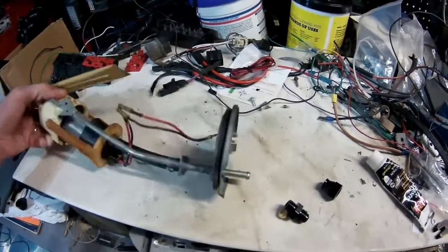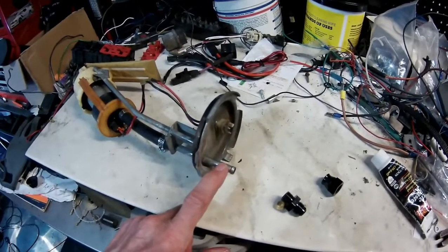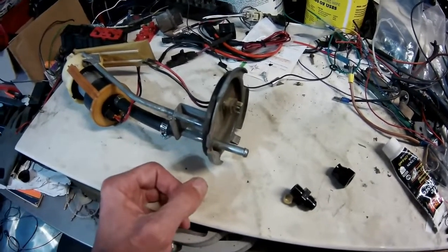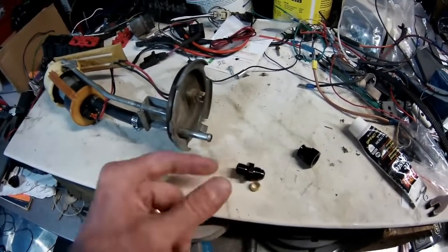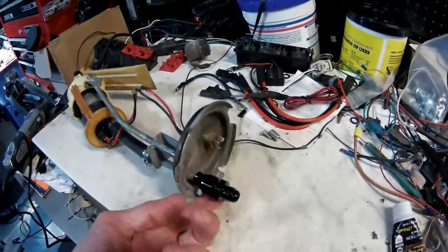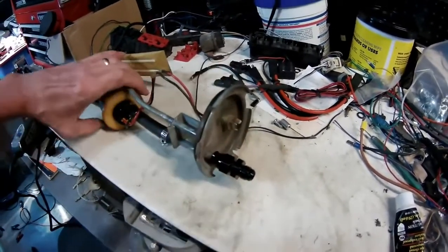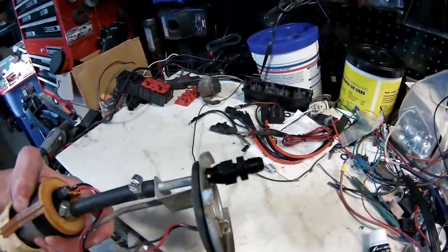This one seems to work. I'm a little concerned in that this is a 3/8 nipple and I'm going to go to a half-inch hose, so it's 8AN. I'll just adapt it up from here to get into the fuel line. So here's the finished product — it's got a 6AN fitting on it with a ferrule inside. That's not going anywhere. So now I can run a braided flex line off that.